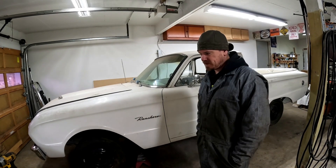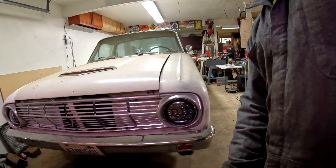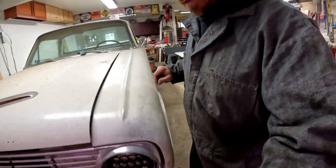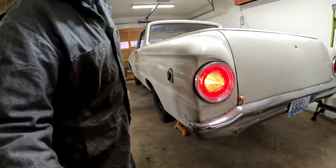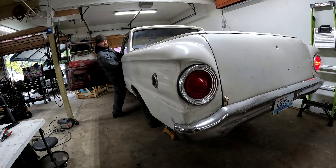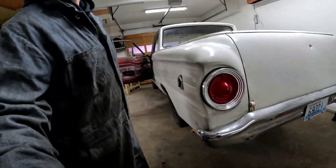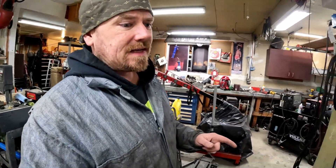Exhaust is done. I think that converter box for the rear blinker brake light - maybe there's not enough of a draw, kind of like the flasher issue. I got the front flashing and that works fine. But when you come to the back, the light turns on, then when you hit the brake it goes out. With no blinker, hit the brake, the brake light comes on. So I believe I need a different converter box, kind of like I had to get a different flasher.